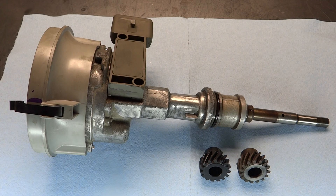So far, what we've got in terms of distributor gear materials is steel, cast iron, and bronze. Back in the day, you used bronze on a steel camshaft. But the problem with bronze is that it would save the camshaft, but eventually that bronze gear would wear out. From what I've been reading, when people advertise their bronze gears, at least in one situation I looked at, the description said it's not for extended use. To me, that would mean a racing application — an application where the engine just doesn't run for long periods of time as it would in a street car.